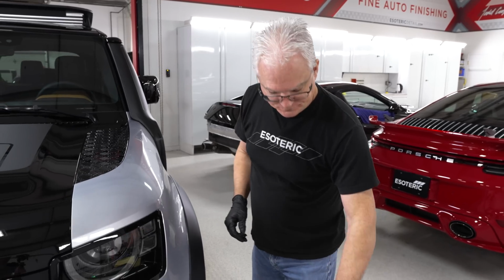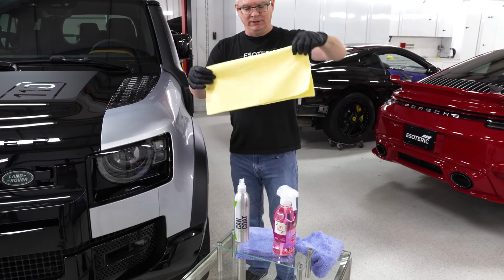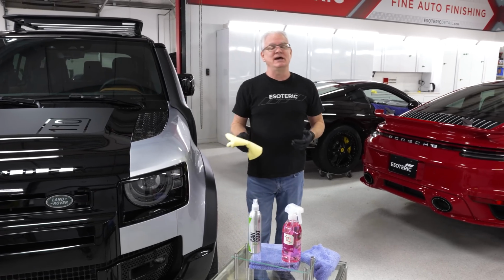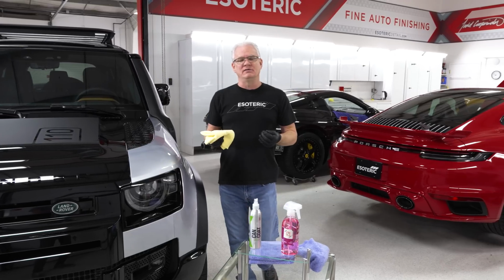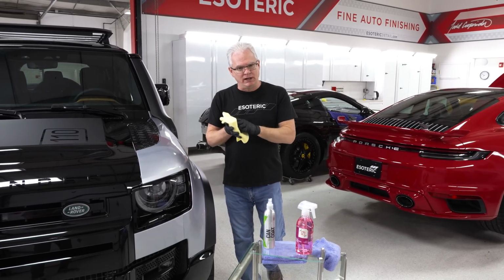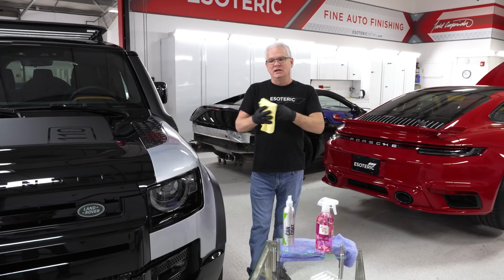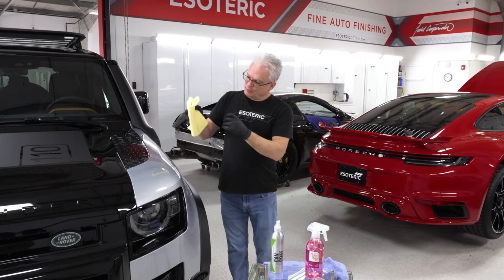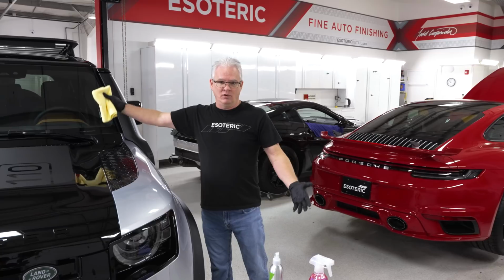All right, now, one thing that I want to talk about when you're applying this is a fine mist that comes out. Because of that, you want to be careful. First of all, we're wearing gloves. Second of all, you want to make sure that you're spraying it right into the towel, and I'll get up close on that here in a minute, because this kind of vaporizes when it comes out. If you're spraying from back here like we do on a lot of other products, it's going to go everywhere.